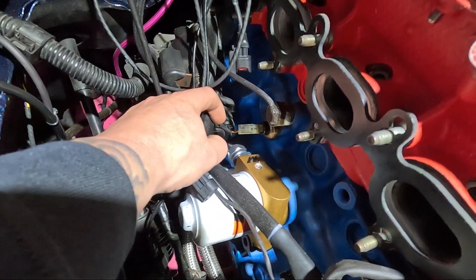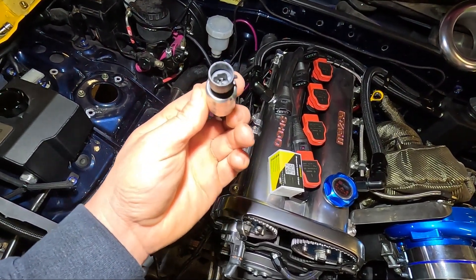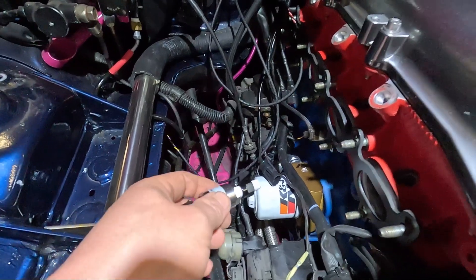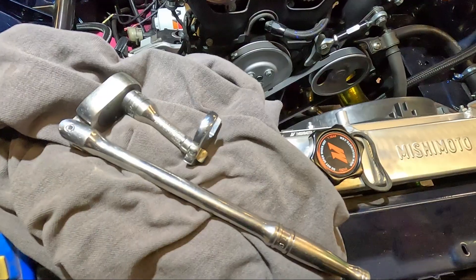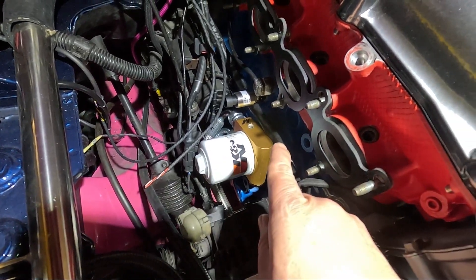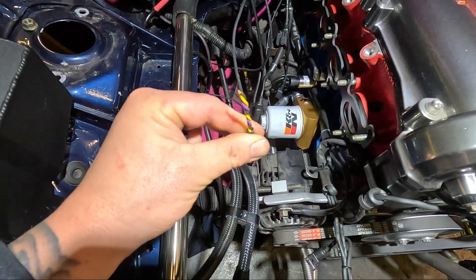The old pressure switch is just one wire — we can unplug that, as the new pressure sensor has three wires and runs on 5 volt. It was a little bit of a pain to do up with that knock sensor in the way. I ended up using an extension with a crow's foot, as the hex to do it up is at the back of the sensor, closest to the block. But it's all in now, and it's time to put a plug on the end of these wires. We've got three wires: sensor ground, 5 volt power, and 5 volt signal.